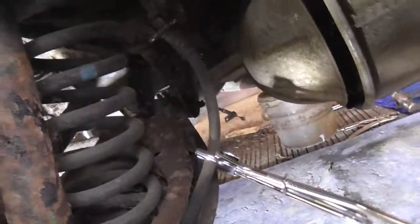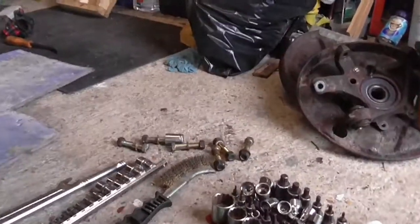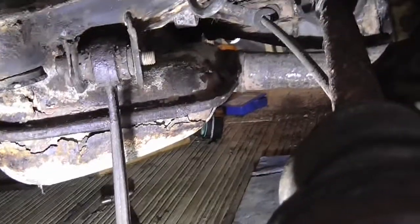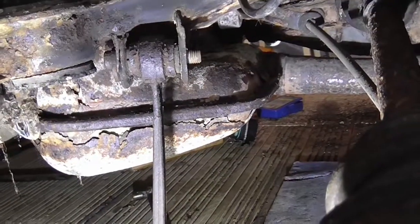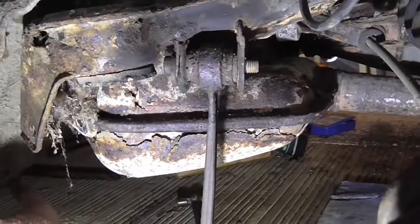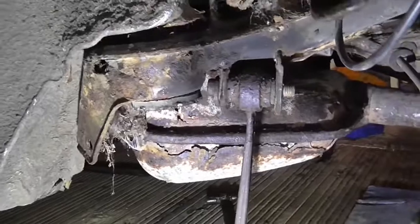The rear spring looks alright — there's no corrosion on there, that's amazing. Yesterday I pulled the prop shaft bolts — there's six of those through a rubber coupling. And because the next thing I've got to do to drop the diff is drop the muffler, I've just cut those three bolts holding the rear two boxes to the front. I'll take you under there in a minute and show you what I've done.